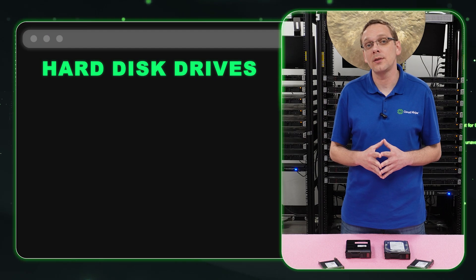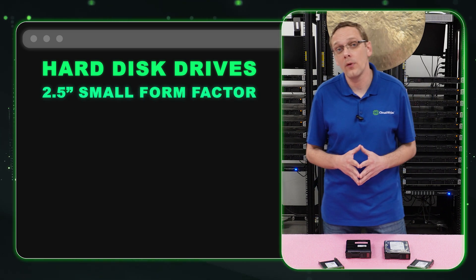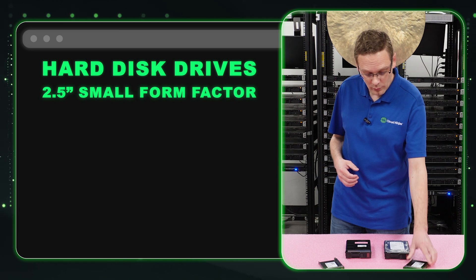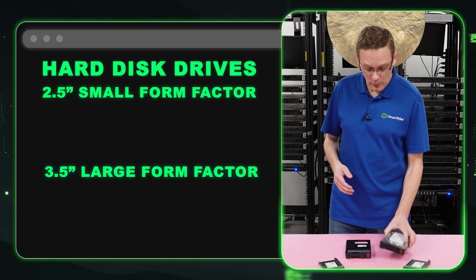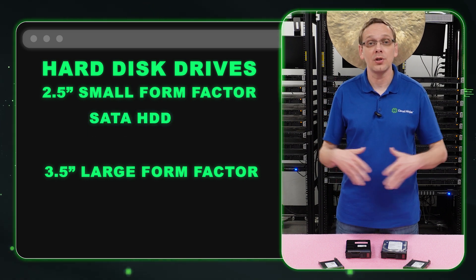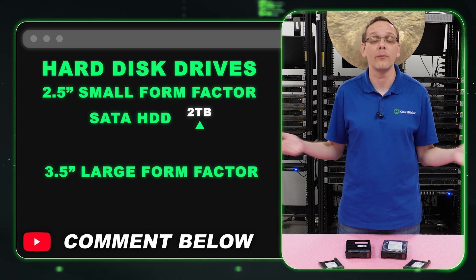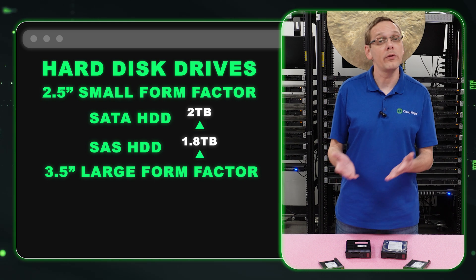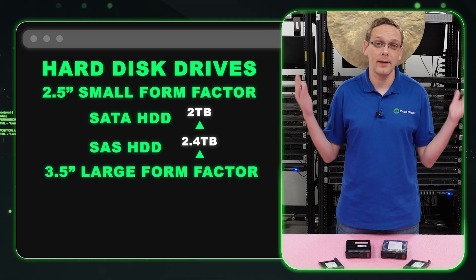The sizes really depend on what type of chassis you have. If you have a small form factor or 2.5 inch chassis, the drives are going to look like this. If you have a 3.5 inch or large form factor, the drives are going to look like this. With the small form factor chassis for a SATA hard drive, HPE spec sheets show two terabytes — that's the most we've put in, though I wouldn't be surprised if someone drops a comment saying they've put in four or something higher. With SAS hard drives, HPE spec sheet shows 1.8 terabytes; we've put in 2.4, and again I wouldn't be surprised if someone has gone higher.